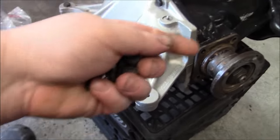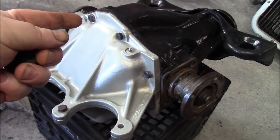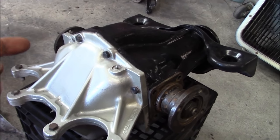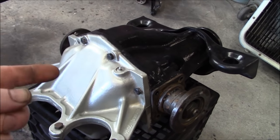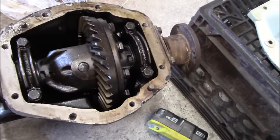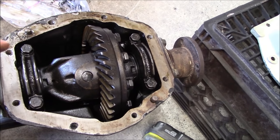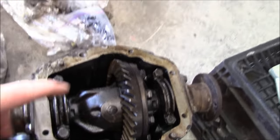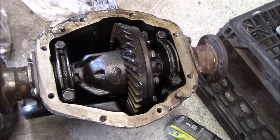We've swapped the axles out and we're just about to bolt them back in loosely, then pop the cover off. It's recommended to use two thin gaskets on this — they're very thin paper gaskets, so we'll use two if there's no gasket in there currently. And as I suspected, no gasket. So we'll go inside, grab those gaskets and the differential mounting kits, and we'll be right back.